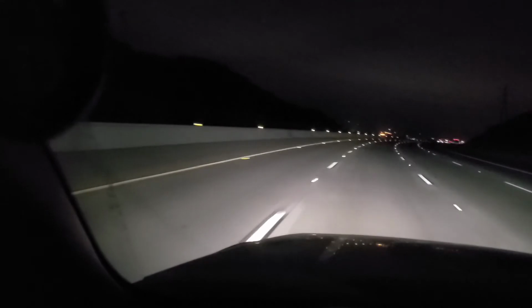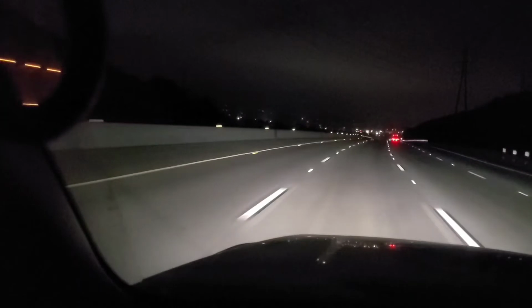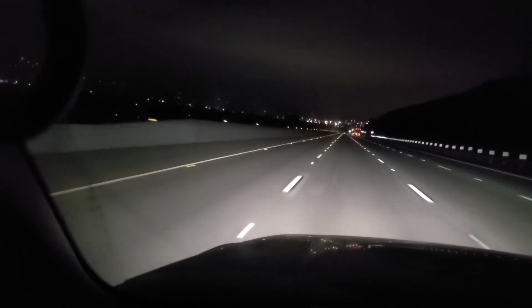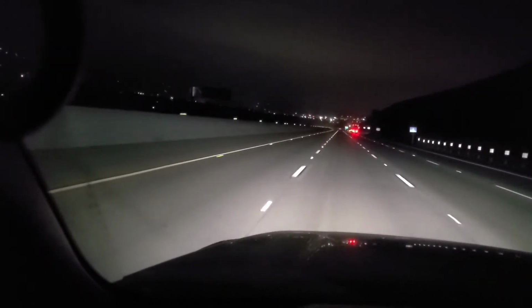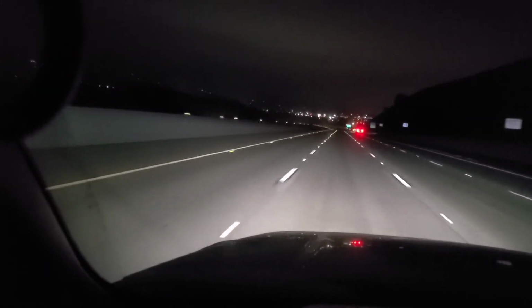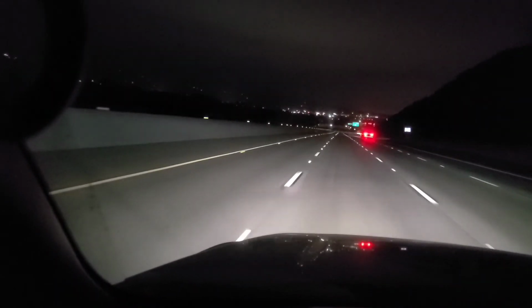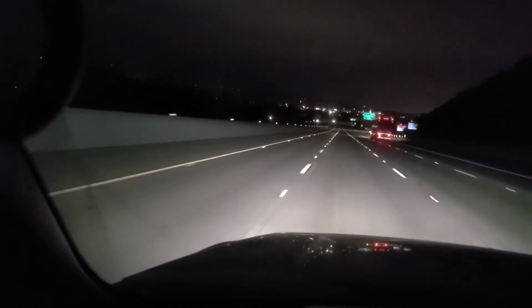And so likewise, on your box truck, the safest combination you can find will be air brakes with disc. I'll see if I can insert a couple pictures that show how, at a glance, you can see the difference. Basically, your air brake can faces forward and aft on any axle, and it's designed to push on the S-cam, and that pushes your pads to generate the friction.